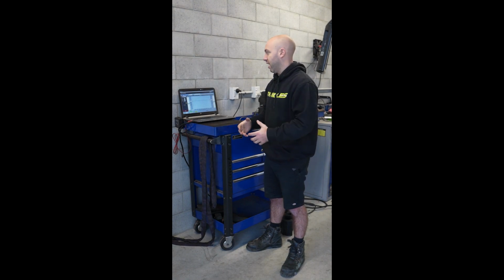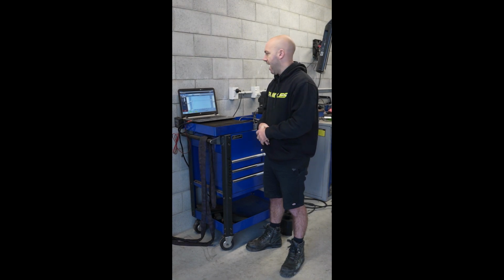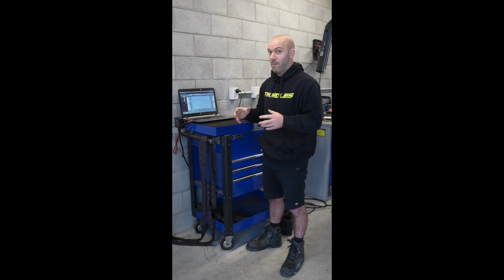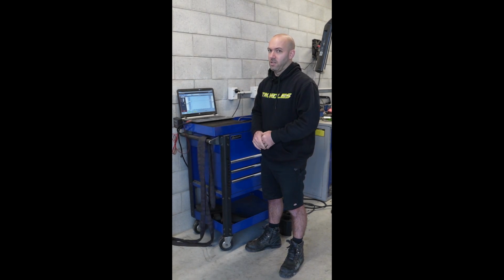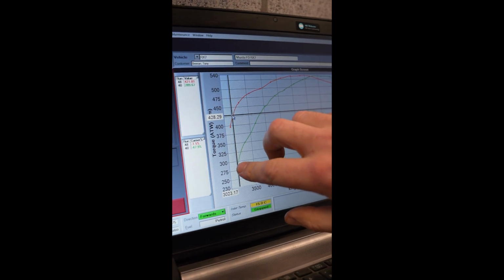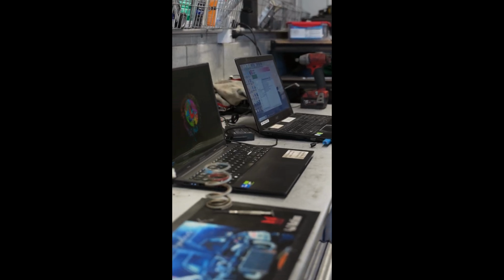However, at this stage we're making the same torque at around 3 psi less boost, and the power is very close at about 5 psi less. So 50% more torque at 2900 and about 1200 RPM lower we're making full torque roughly. You'll see right here we're making 280 Newton meters on the money, and up here we're about 428. So I'm just going to show you guys over the boost.